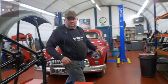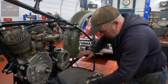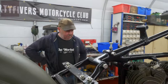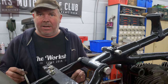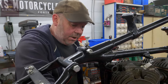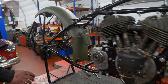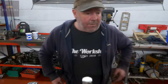What I'll have to do is go through the parts manual and check whether they should have flat washers and where they should go. Let's just get it all in for the moment and we know where we're at. People put washers on there but it doesn't necessarily mean it had them - it might have a lock washer but I doubt whether they put a flat washer on it. The parts book should tell me which way through all the bolts go as well. Then I can centralise up all my casing bolts, get it all locked down solid, and Bob's your uncle. That's about it for getting the engine in - I'm pleased with that, nowhere near as painful as I thought.